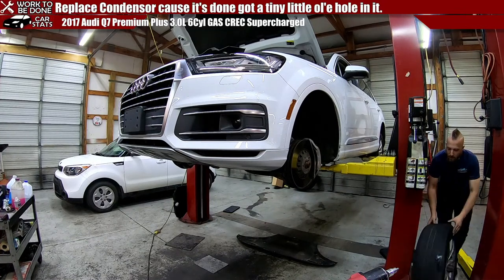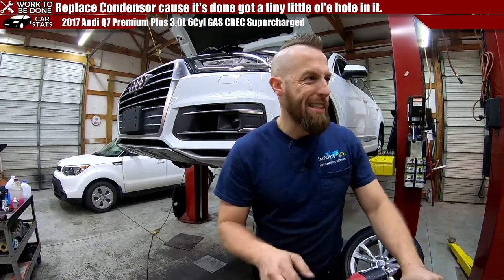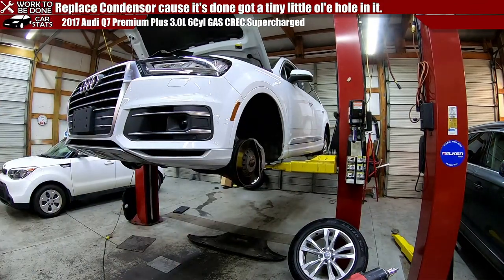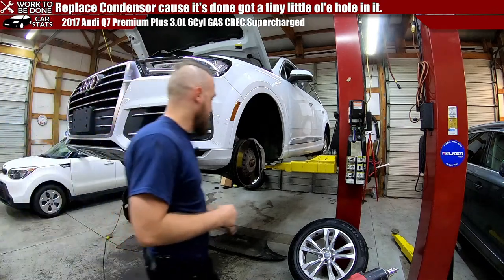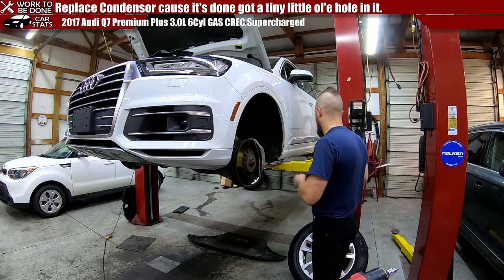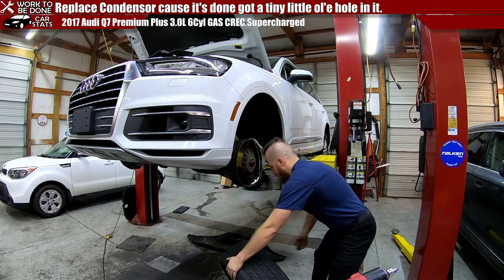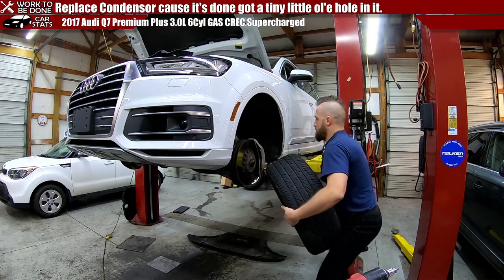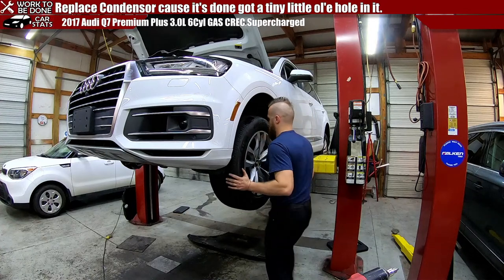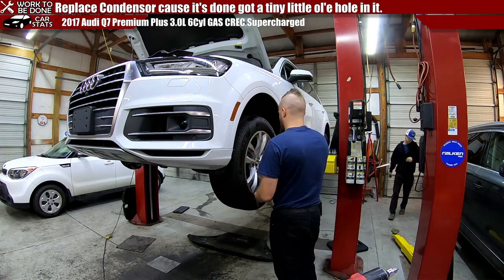Guess what, boys? We did squats today. Remember, use proper technique when picking up your tires. Save your back. You only get one. Especially with these that don't have studs on there. What I do is keep a bolt loaded up in a socket so that way you can stick it in there real easily and quick. And so, bonk, there we go. Get that on there, line it up, and then away we go.